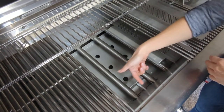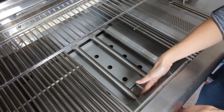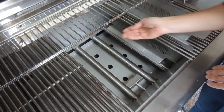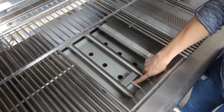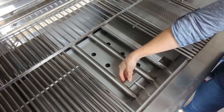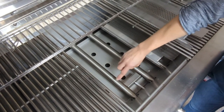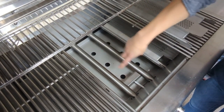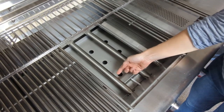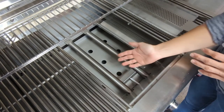The burners are connected into the manifold and valves behind the face plate of your grill. You can't see those, but that's what allows the gas to go into your burner. Here we have the electrode — this one's connected to a collector box that will collect the gas and light it, and once that's lit it will light each burner. Some electrodes are pointed straight at the burner and won't have a collector box, because they'll light the gas that comes out of one of the holes.